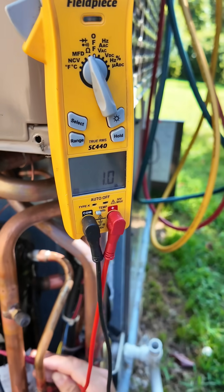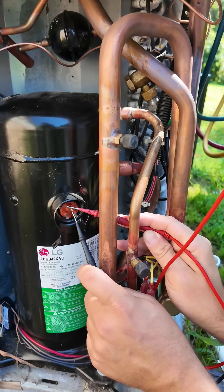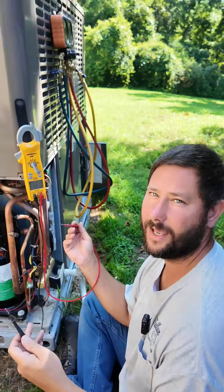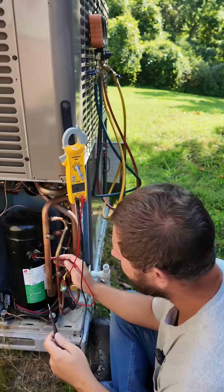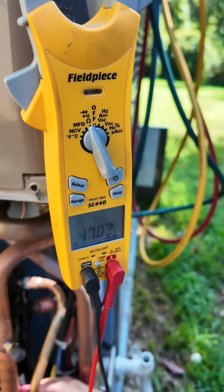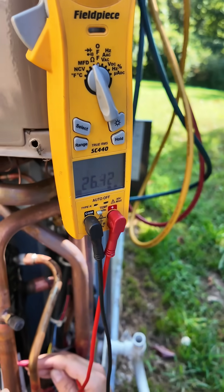Start to common is 1, and then common to run is 1.1 — so it just about adds up. Now when you go from each winding of your compressor to your copper, you shouldn't read anything, because that would indicate that we are shorted to ground.